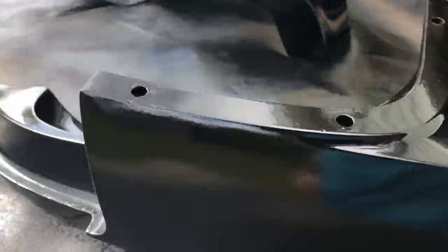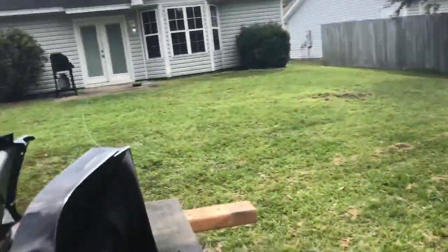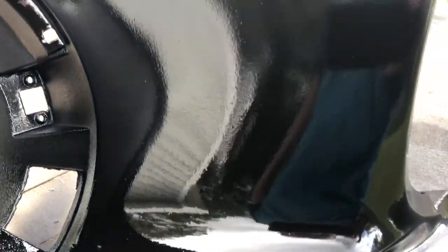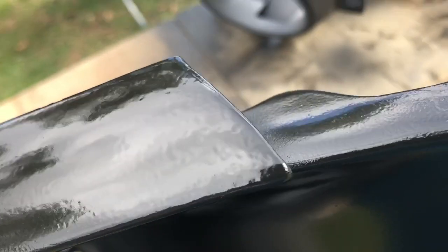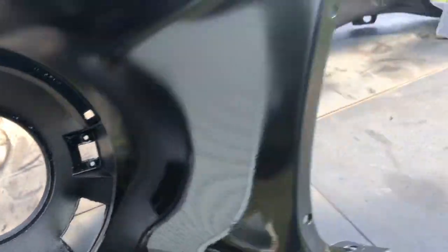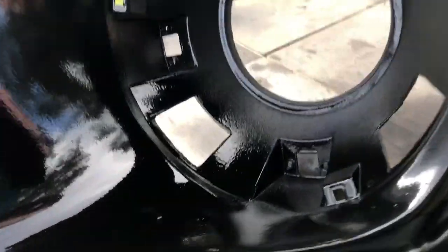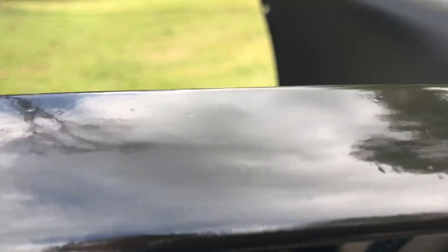Another reason why I think my epoxy is starting to get old is that it's not spraying out smooth like it was when I did the dash. I'm getting a lot of fisheye. It's not everywhere real bad like it was up here. Yeah, you can see the craters in that. I mean, this is all going to go back and be body worked better. I'm going to end up re-sanding it and using some filler in areas like this crack here and so on. But yeah, you can see the nasty craters here, and it gets smooth in areas like that. And inside of here, it's just fish-eyed up like crazy. Nice and glossy though.